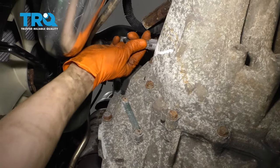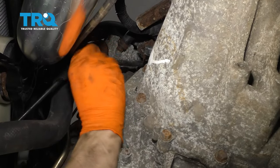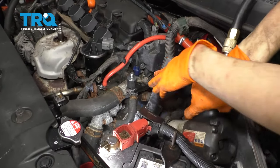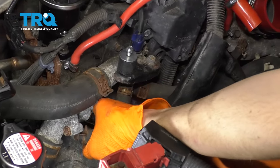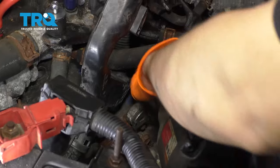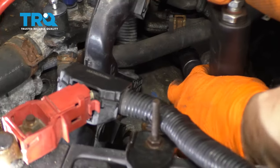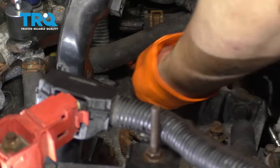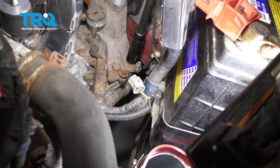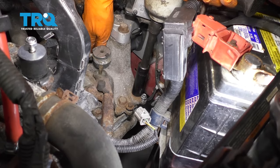Unplug this electrical connector here — you can do it from up above, but sometimes it's easier to do it here just because of the position of the little locking clip. Set that aside and make sure it's not wrapped around anything that's going to come down with the transmission so it doesn't rip the wires. Now I'm going to disconnect the two top bell housing bolts — two 17-millimeter bolts right underneath this thermostat housing. There's one. The second one is really hard to see but it is somewhere underneath here. I'm going to take this one off and the one in the back — because I'm working on the lift I'll leave two for me to do from underneath.